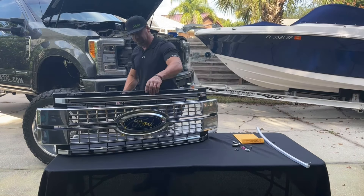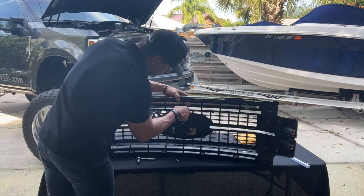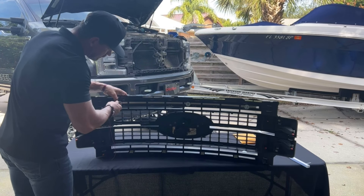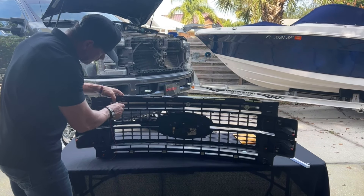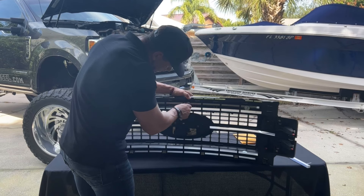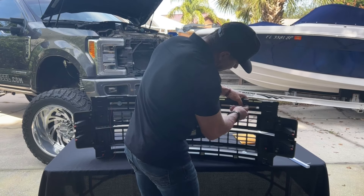Now you've got a little installation kit that has some nuts, washers, and butt connectors in it. When you put the light in, it has studs that go through it. Just make sure the light is centered in the grill the best you can. These studs have lock nuts so they're not coming off, and the lights fit in the grill pretty well. Just tighten those up enough — don't use an impact because those studs tap into an aluminum plate and you don't want to strip that out.